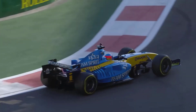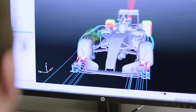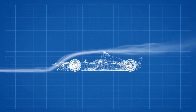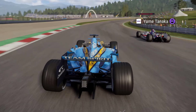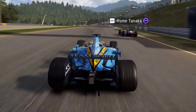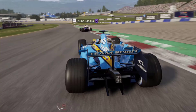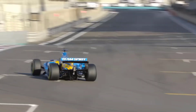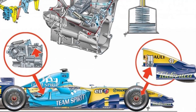Renault and Ferrari then transferred the principle to the rear of the car as well. At Hockenheim, Honda wanted to run a system with one mass damper in the nose and one other in the tank area, but 13 days prior to the race the FIA banned the concept with the argument that it is a movable aerodynamic device. This action was a bit strange because the FIA could have been aware of this argument already the season before and at the start of the 2006 season, when they allowed various teams to use it. They were afraid that other teams would develop these concepts into something extreme. One team, for example, was asking whether they could try a 30 kilogram mass damper oscillating not only in a vertical but also horizontal and diagonal direction. For those who were able to set the system up in the right way, it was a clear advantage.